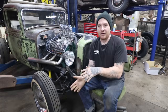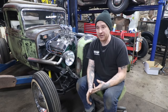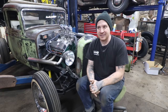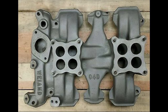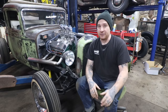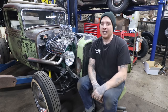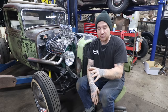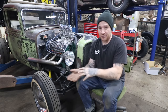When you get into the later intakes, they are actually far less common for whatever reason. The 371/394 intakes, unless they're the 6x2 style build-it-type intakes, seem to be a lot less common. And you start seeing 2x4s and things like that because when they got into that area, the engine started getting quite large, and when you hop them up, it's much easier to just go to two 4-barrel carburetors — that is plenty of fuel. That's why I've kind of leaned when I built this car towards the 324, because it was a lot easier to find speed equipment and parts versus the other engines.